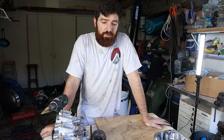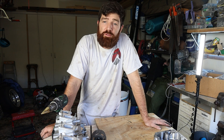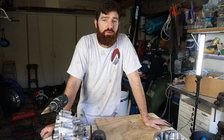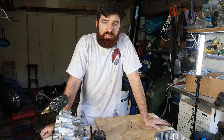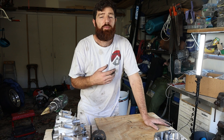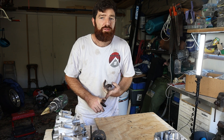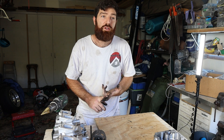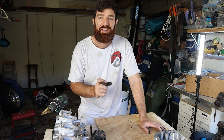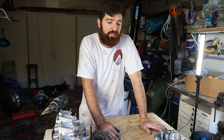These cylinder heads are prone to cracking — it's no secret, and that is coupled with overheating. These cars can overheat if you push them, and people do push these cars because they're a workhorse. They're apparently unbreakable — that's a lie — but they are very well-built, strong, reliable cars. The issue is when you're towing caravans up hills with big tyres, the car is way heavier, it's a hot day, and engine temps start to creep up. If you haven't done modifications to monitor exhaust gas temperatures or EGTs, and you're not monitoring water temperatures accurately with a degree-readout gauge, and your car overheats, you're going to crack your head. Any car will crack its head if it overheats for long enough.